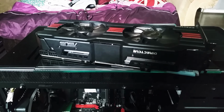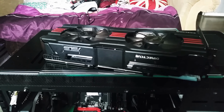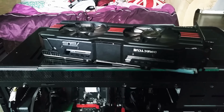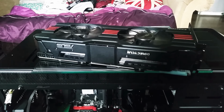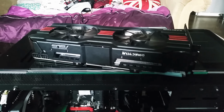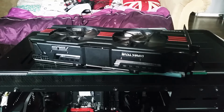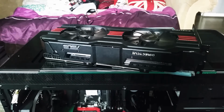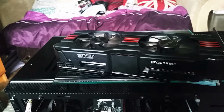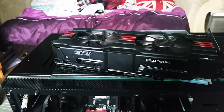Basically, it's a very slimmed down version, without the water pump and water block, of the Alphacool blocks, you know what I mean? Because it's the same thing. If you look inside an Alphacool block, it has the recesses cut out of it, and the bit sticking out where it touches the memory chips, stuff like that. And this has got all that, but you can't take the fans and the heat sink and the fins and that away, and leave that behind.